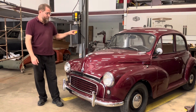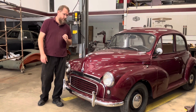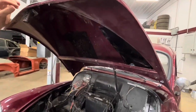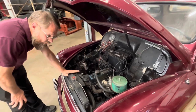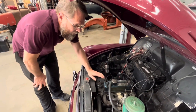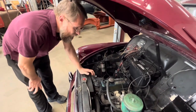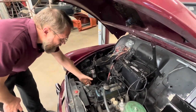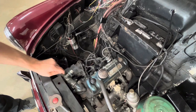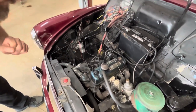We're going to be looking at that, and of course when I brought it in you could also tell it wasn't quite running as well as we want it to, so he did say we're probably going to go ahead and look at that as well. Being that it is an earlier Morris Minor 1000, it has the venerable BMC or Austin A Series 948 in it, single carb. It has been updated to an alternator, and interestingly enough the later 1000s actually had the 1098 in it, but they still call them 1000s, not 1100s.